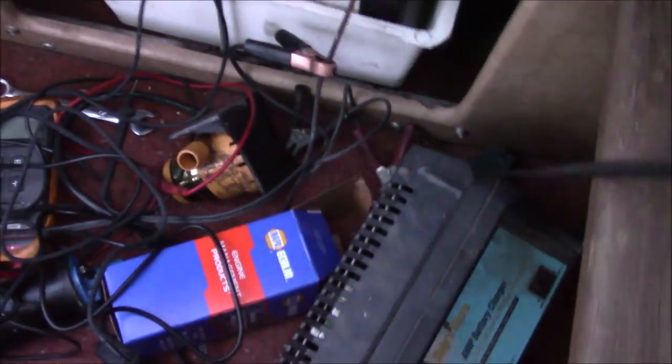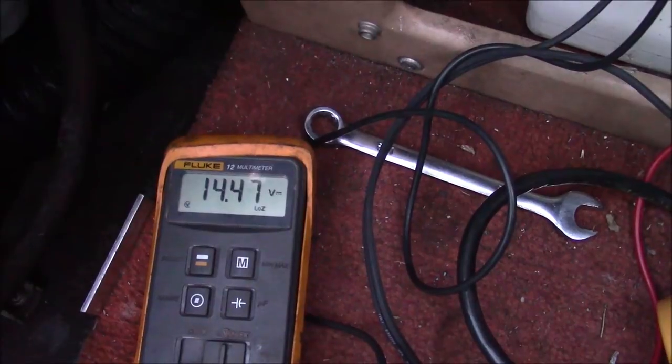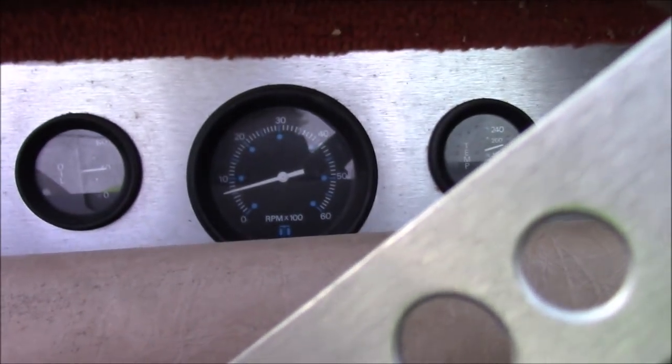The other thing I want to check is whether I'm charging, because I've been starting and restarting. I'm going to put the multimeter on the battery and see if the voltage begins to creep up. Well, it's already at 14 volts, so it's not going to get any higher than that - that means it's charging. Let's shut it off and restart it and see if I'm happy with the way it goes. The spec says 500 or 600 RPM and I've got it at just about 600.